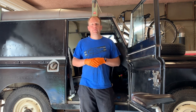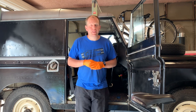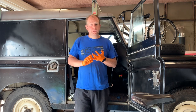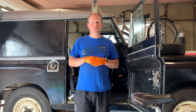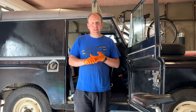I said at the start of the video that I'd talk a little bit about the petrol as well, and let me give you some tips about that. The 2.25 litre petrol engine is much the same as any other four cylinder single carburetor petrol engine. You're going to have to give the carburetor a once over, check your mixture, and also check your timing on the distributor. Depending on whether or not you have electronic ignition fitted, with the old style original ignition, you're going to want to check your points gaps and pay attention to that. Spark plugs, check your HT leads, and that's really about it.